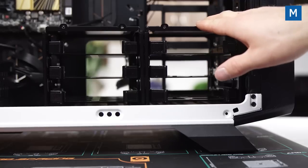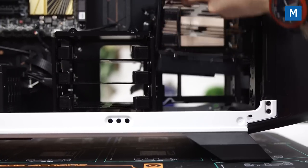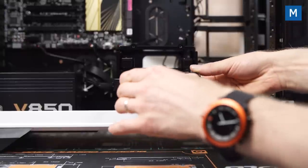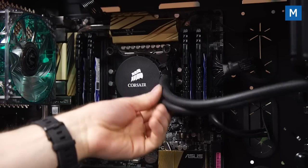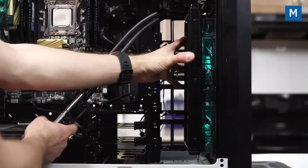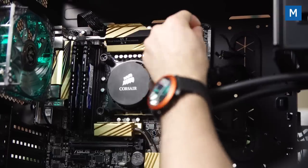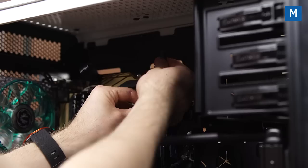Tighten corners lightly first, then all the way to avoid applying uneven pressure to your CPU. Next, clear space at the front by removing the front 3.5-inch drive cage — undo the two screws on the bottom and pop it out. We're using only SSDs, but leaving the second cage gives us three bays for future drive expansion. Position the front 140mm fans using the long screws included with your radiator, then carefully position the radiator behind them and thread the screws in. It takes a couple of tries to align — just be gentle and patient. Plug the fan connectors into the nearest motherboard ports, and plug the pump connector into the CPU header.